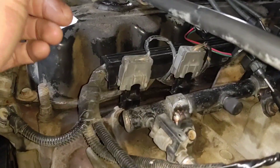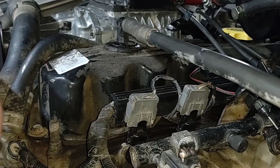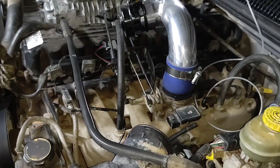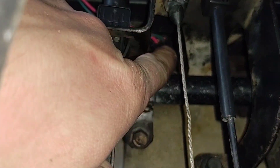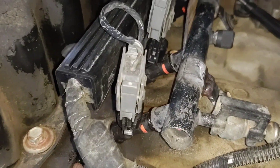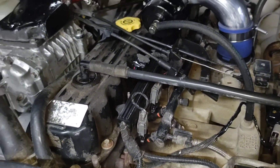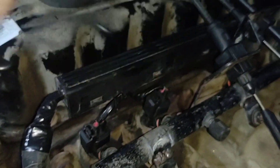Before I do that, I'm not really going to record me doing it, I'm just going to do it. I'm going to quit putting off getting rid of these adapters and just do that now before I put the wideband in. If you haven't seen my other video, the problem with running these adapters is this one right here — by the time I stack that up it's into this bracket. You could get the right size and right connector injectors, but I already had these 47-pound-an-hour injectors out of a GT500, so it didn't cost me anything. All done — swapped them all, no more rigged-up connectors.